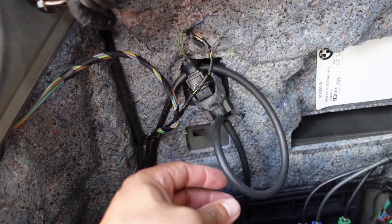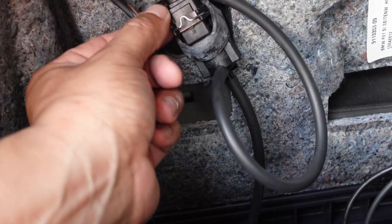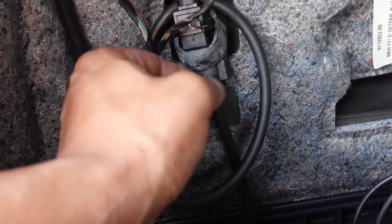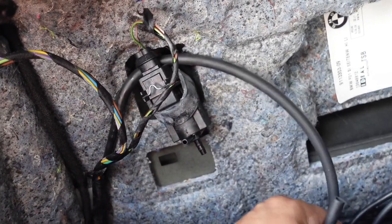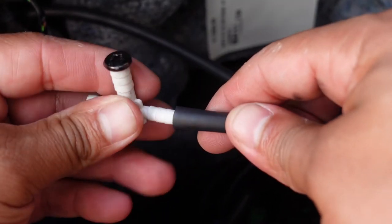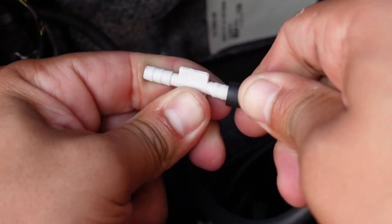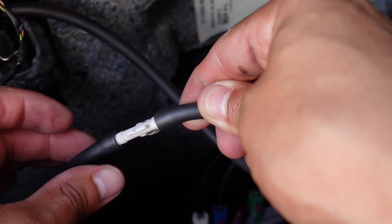So what you're going to want to do here is — I've also seen people just disconnect the connector, but that's going to cause a check engine light, so you don't want to do that. What you want to do is disconnect and remove this vacuum line here, and remove the vacuum line going to the bottom of it. Then all we're going to do is insert the T-fitting that we just bought, connecting them together. I've already blocked mine off with a screw — get it fitted in here, make sure it's screwed down all the way for a good connection, and that is it.